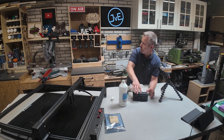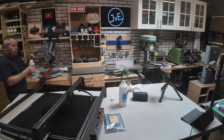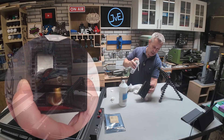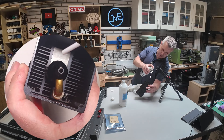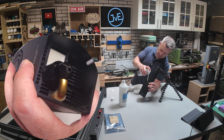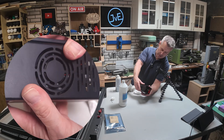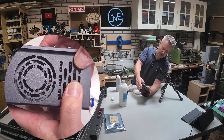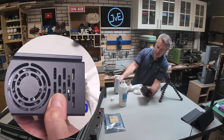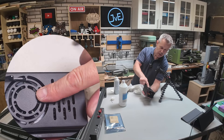You can also use compressed air cans and blast through the vents so everything is nice and clean. The vents look clean. Otherwise you can also clean them, but don't use the compressed air directly on the fan like this, because your fan will be spinning at an RPM it's not liking very much — that's not good for the bearings.